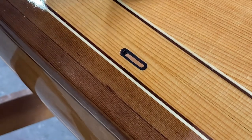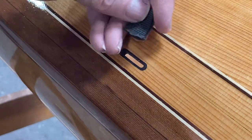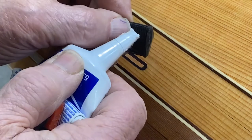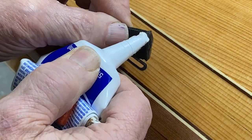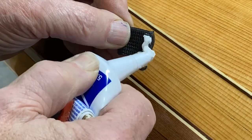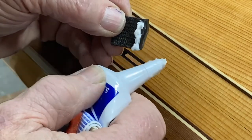To ensure water tightness, caulking needs to be applied around the underside of the mushroom cap. Don't use silicone here — use rather Poly Seam Seal all-purpose clear caulking. It's a white one applied, but it cures clear.